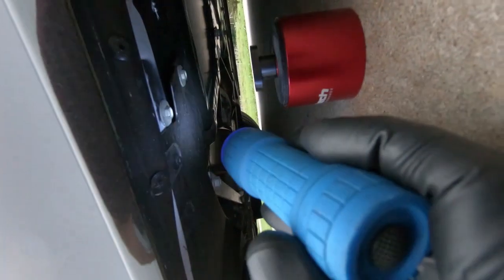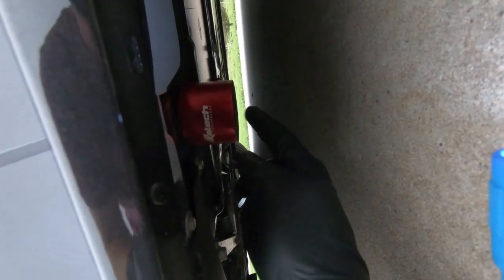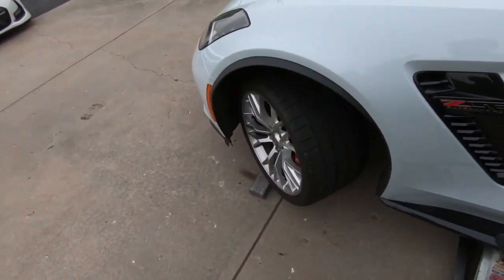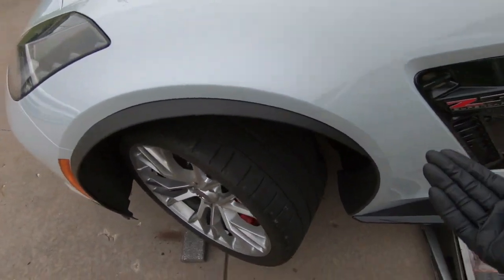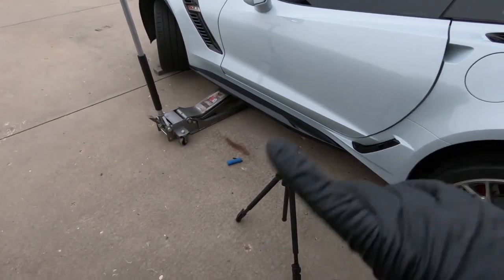On the front, I am going to use one of my billet pieces — they just slide into a spot on the bottom of the car. This turns and gives me a jacking point that's lower than the ground effects on the side. You can use a hockey puck — a lot of people do that — and I'll list these in the description below. Once the car is lifted up, I went ahead and turned the wheel all the way to the right, and that's going to give me access back here to reach that bolt. The next thing we need to do is get our other jack into place — same thing, we're going to push up on that leaf pack in the front.